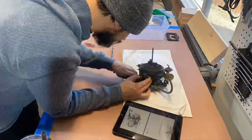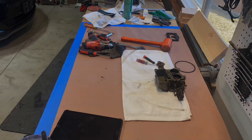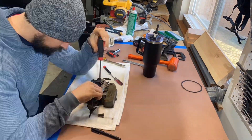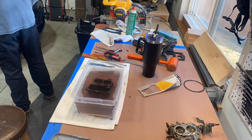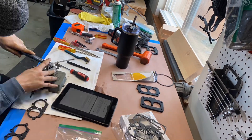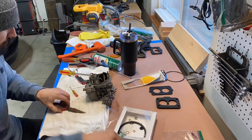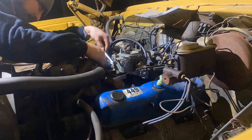One thing I will say about the disassembly: you can look up Holley 2245 disassembly instructions online. Mike's Carburetor Parts is online and they have a free PDF you can download — I'll link it below in the description. That was super useful. Basically the carburetor consists of three parts: the air horn or bowl cover, the carburetor assembly, and the throttle body assembly. I highly recommend that when you take everything apart, follow the instructions, put everything in bags, and label the bags based on the number in the instructions so you know exactly how it came apart. Once you get it apart, you want to soak it and clean it. I used a mixture of Simple Green and water — but not just any Simple Green. You want to use the right type that won't destroy aluminum parts. I only let them soak for about 30 minutes, cleaned everything, blew it out with air, rebuilt it with a $20 rebuild kit, and then installed it back on the car.